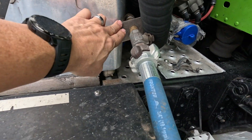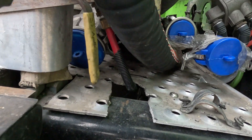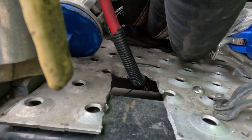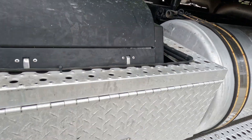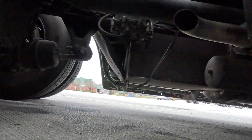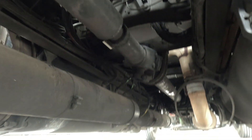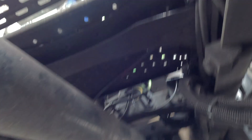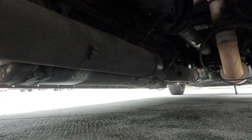Here's how I have my setup. I've got a brace here coming up holding it. I have a ball valve right here. This ball valve opens — as y'all can see, we have my air line. That's run down through the frame, run down underneath, and that is tied directly into my air tank. The line is in wire loom, runs down the frame, and then drops down and ties directly into my air tank.